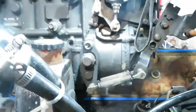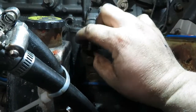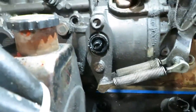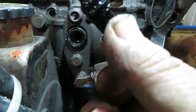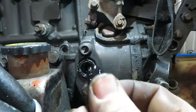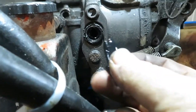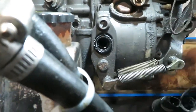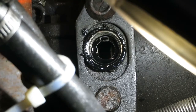To find the timing pin on the pump, come over to the side — there's a plug right here, I think it's a one-inch plug. Pull this out and you will see this little guy sitting in there. It's pretty clean but you can see there's a slot in the end of it. If you look in here while you're rotating the engine over, you will see a tab going around.